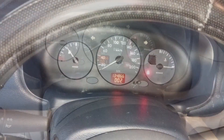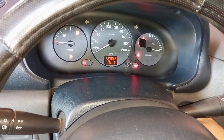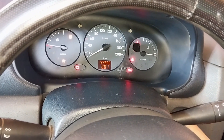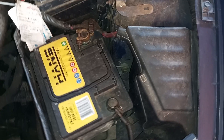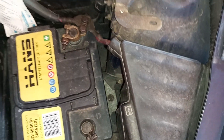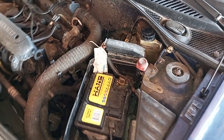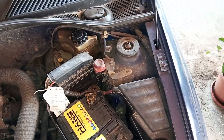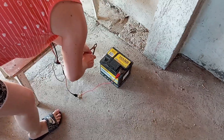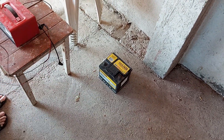If, however, despite the charging, the car will still not start — there are no lights on the dash and it won't crank — then this is a pretty sure sign that the battery is bad and you'll need a new one. In this case, additional recharging will not help. If there are no lights on the dash and everything seems dead with no signal when you turn the ignition key, then additionally check the battery terminals to make sure they are cleaned and tightened. So that's it for this time — we hope the video helps. Please like and subscribe, it's a huge help for what we're doing. Thanks for watching and thanks for your time.